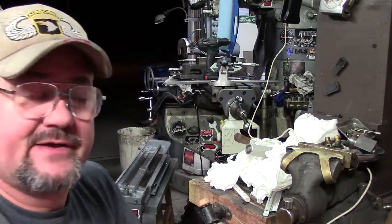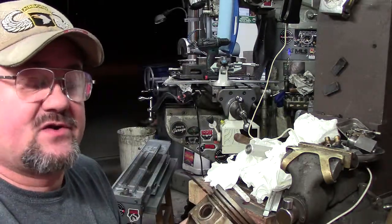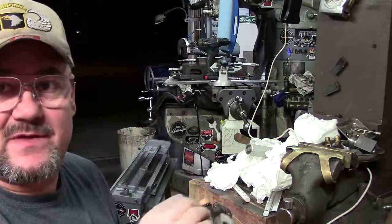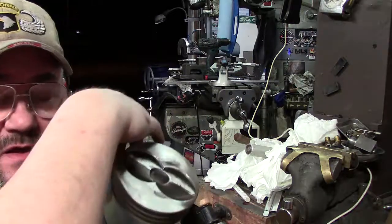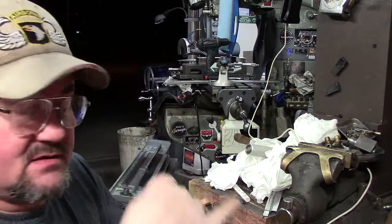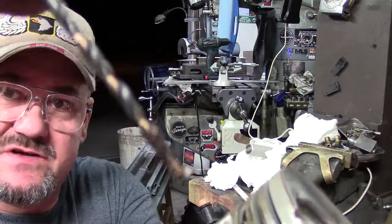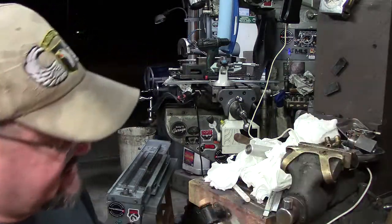It's a sludge pocket. For those of you who don't know, certain pistons have sludge pockets, and also cranks, on different cranks and different motors, you'll have either a ball bearing in there that you've got to machine and drill out, or a cap, same thing in the oil galleys. And I'm going to hand polish that crank on this lathe. So I'm going in here, you just press down, and you can see as I pull it out all of the junk that is falling out.